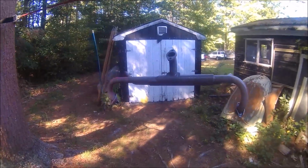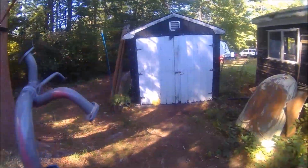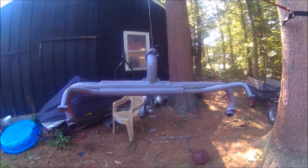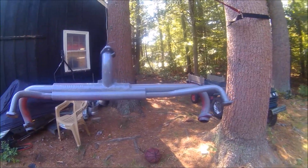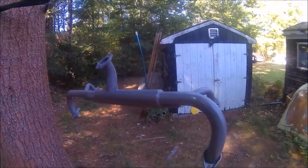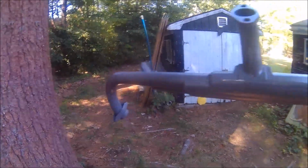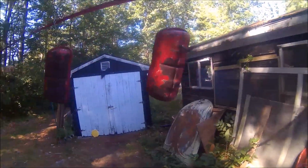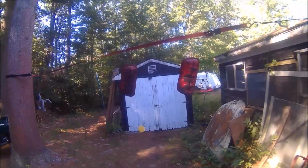Already looking better. There are no shortage of videos out there if you guys want to learn how to spray paint with a spray can. What I do is several light coats, and that's what I go with. Well, the intake's got a couple of coats on it now, and it's coming out really sweet. And so we're moving on to the valve covers. We got them all sanded down and ready. They're supposed to be black, so we'll paint them black, not red.